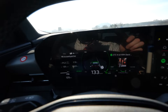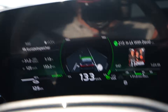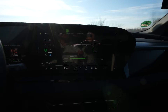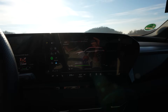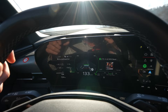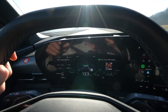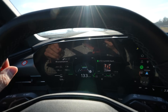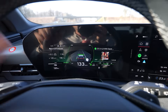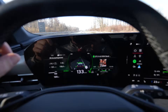I'm at 45 percent — used 50 percent of the battery over 152.5 kilometers, projecting about 305 kilometers of full range. It's now one and a half degrees outside. I put the heat to 23 degrees and turned off efficiency mode because the sun is warm but the foot area is cold. The range display shows that with 45 percent left it thinks I can only drive 124 kilometers — that seems odd given I drove 150 on 50 percent. Consumption is 311 watt hours per kilometer.